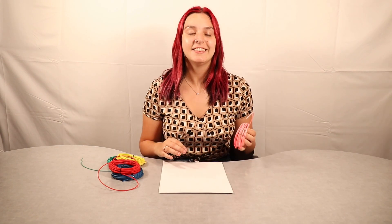GPT wire is hygroscopic, which means it absorbs moisture over time. This makes it less suitable for many applications when compared to a cross-linked wire like GXL and TXL. While it was much more widely used in the 80s, GPT wire is considered an El Cheapo wire. Some PVC wire out there only has a temperature rating of 60 degrees Celsius, which is 140 degrees Fahrenheit — not more than a hot cup of coffee. This is the kind of wire that big box automotive stores tend to sell. It melts easily during soldering, which can be an issue when splicing into harnesses.